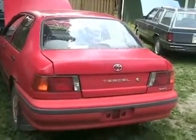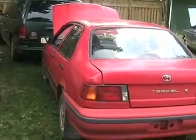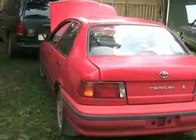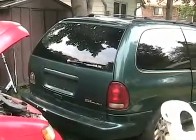So unless you're starting with a whole complete kit that was engineered for the engine you are using it on, you're almost out of luck if you want to increase the performance on your car by adding forced air induction. Because likely your grocery getter won't work right, will burn the valves, have white spark plugs, pre-ignition, and lots of problems, and maybe even less horsepower.